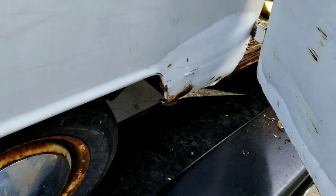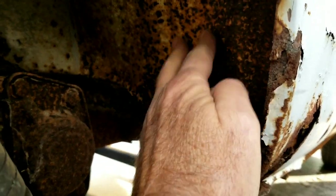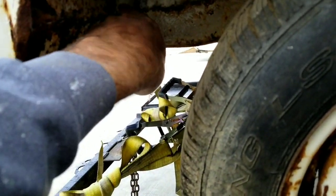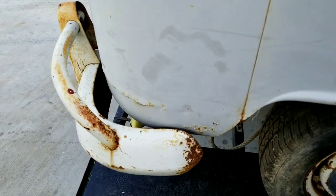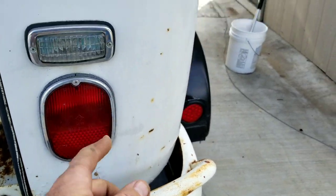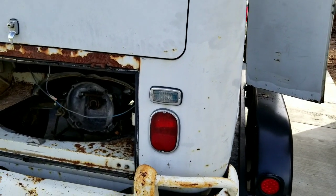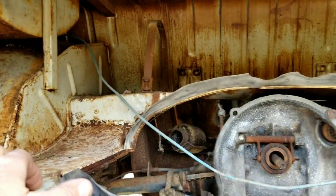This is a cool '67 bus — it'll be neat when it's all done. I'm thinking this thing probably came from Washington, doesn't look like it was midwest. Those bottom corners are rusted out — that section I almost always end up replacing. I'll probably end up making those corners because everybody wants so much money for them. Northwest Metalcraft has the mold — those corners used to be like 500 bucks and now they're about 250, which I still think is too much for a simple pressed piece of metal.